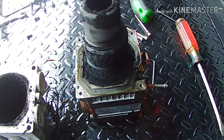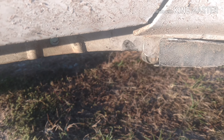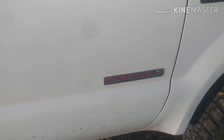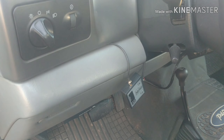After cleaning it out and firing it up — that was just pre-starting it — this is how loud it is. It almost sounds like a blow dryer on low setting. You can hear it ramping up a little bit. It's actually blowing pretty clean now with the new glow plug and the muffler removed — it's got a nice flow through it. You can hear the pump clicking — it's not too loud. This truck is straight piped and idling, so it's way louder than this heater will be.